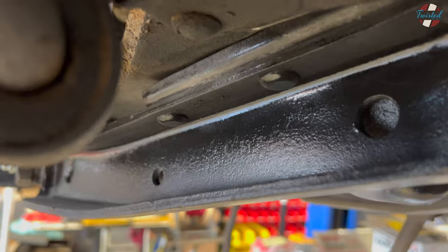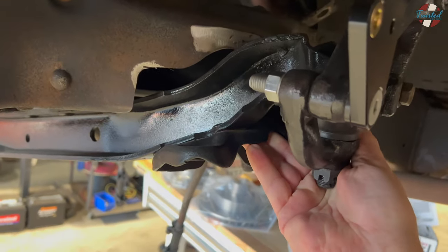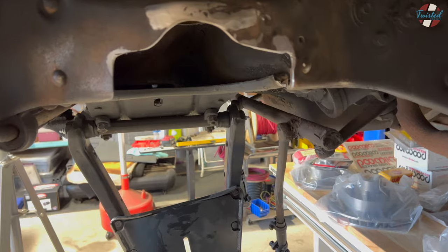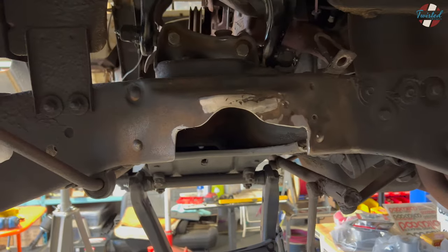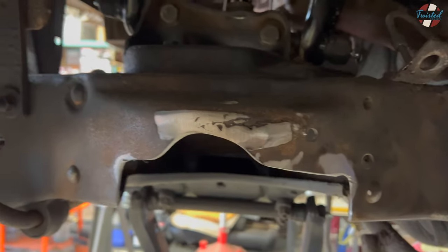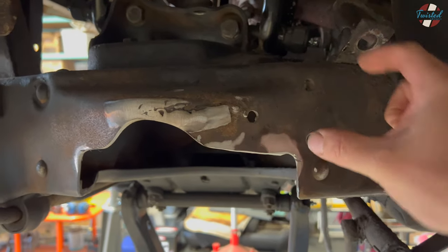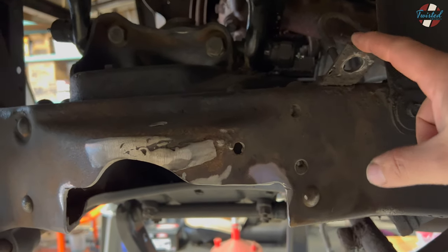That part of the arm is touching the bottom of the frame right there, and this is basically going to have us laying flat out on a 20-inch wheel. So we've got the clearance we needed. I've got to do a little more cleanup on all of this. Then we can measure up for our upper shock bracket. I'm probably going to use the plates we run on Buicks — it's really similar to our Impala bracket, just some slight geometry differences. That should nestle right in here and come up just to the side of the brake line bracket.